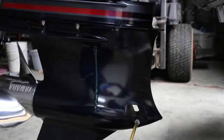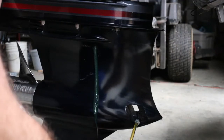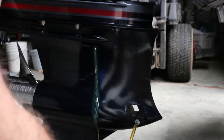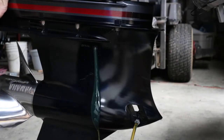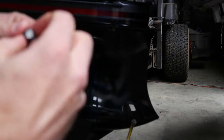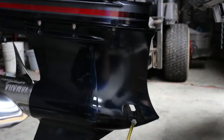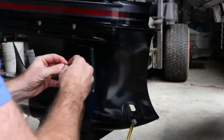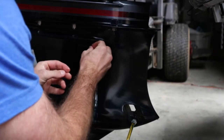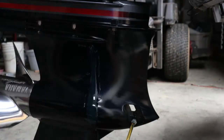Keep on pumping. You see it starting to come out the top — I'm going to keep pumping till most of the air bubbles are gone. You've got about three quarters of a quart to play with, so give it to it, make sure it's good and full. Partsview does give you the gaskets and everything too, so be sure to swap out your old gaskets and put some fresh ones on. I'll give it a little bit more right there, then shove this screw in — thread it in there, make sure it's snug.